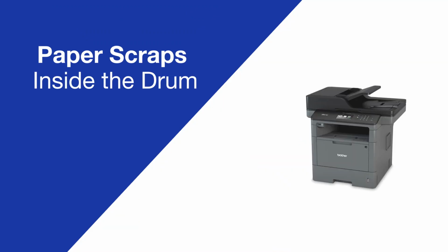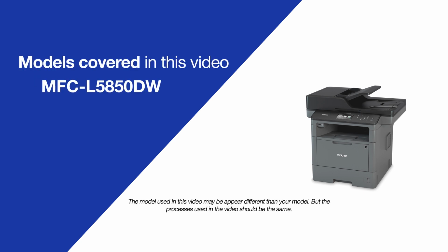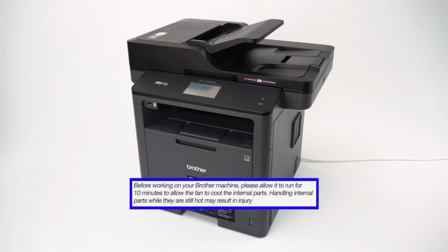Today we're going to clear paper scraps inside the drum on your Brother MFCL5850DW. Before working on your Brother machine, please allow it to run for 10 minutes to allow the fan to cool the internal parts.